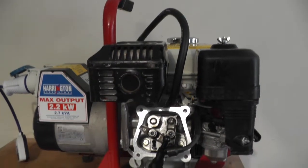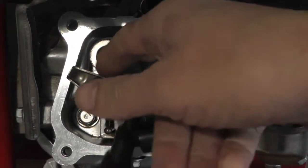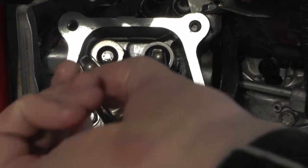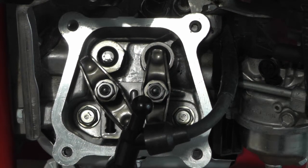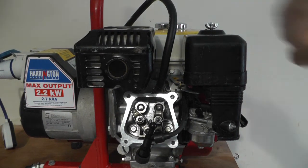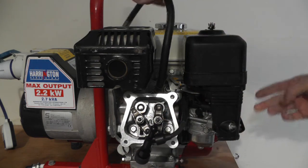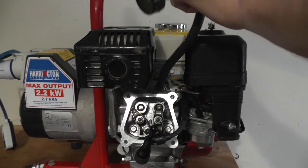To test the compression on dirt engines, you need to pop the rocker arm off the exhaust side valve and pull out the push rod as well so you don't cause any damage. If you don't do that, the decompression lever opens the exhaust valve and you don't get any compression. Pull it over a few times with the spark plug out, gas off, and the meter connected.